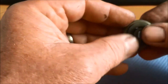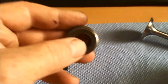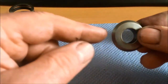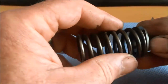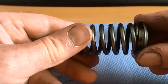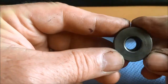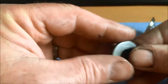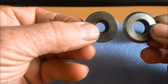I thought I was going to be able to use four of them for the exhaust side and four of these for the inlet side. It wasn't until this morning that I realized the exhaust valve springs are smaller and therefore this will not fit in. I've also checked this morning - these are hardened, and there is enough material in here that they could be machined, but they'll have to be ground out to create the same internal dampener shape as this one.